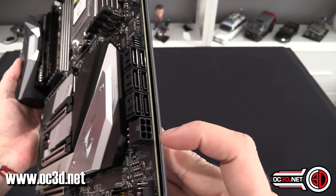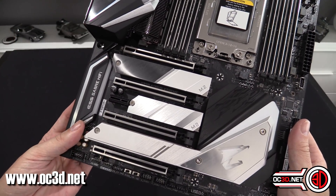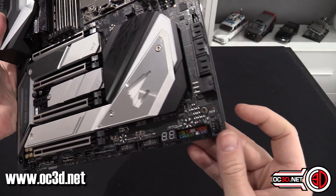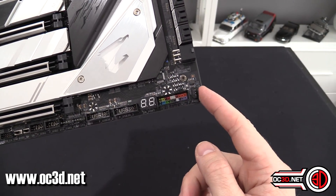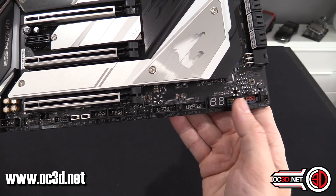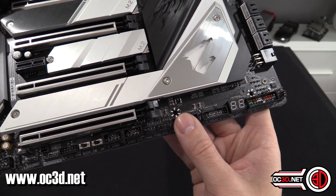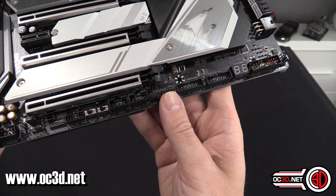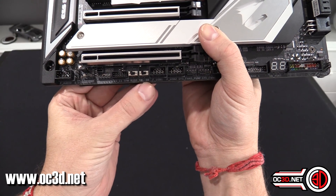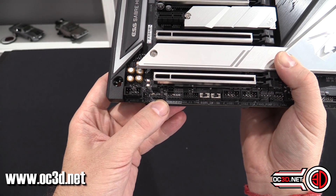You've got your six SATA ports and PCI Express. There's also a PCI Express power connector here to feed extra cards if you're completely packing it out for something like a render machine — if you're a normal user this probably isn't going to help you. There's another fan header, a POST code readout, front audio, front panel headers, two external USB 3 headers, two external USB 2 headers, two more fan headers, a BIOS switch, and what looks like an SB switch — I'll have to read the manual on that. Then you've got your RGBW and addressable RGB headers.